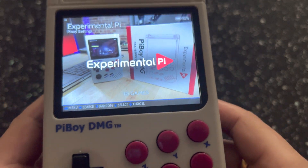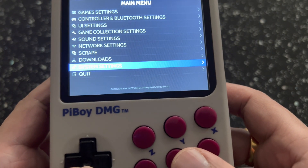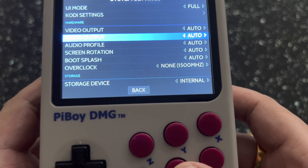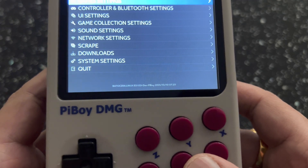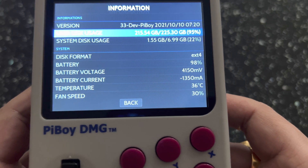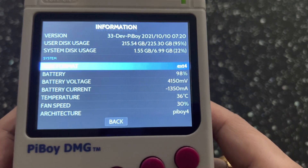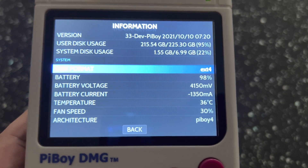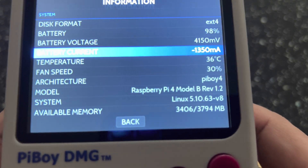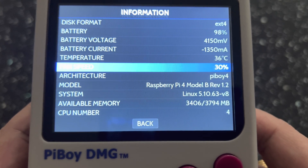You can see you have a battery meter here. You can bring up the menu. Let's just go to the About screen so you guys can actually see a bit more information about the device. So under System Info, right at the top — the format is EXT4, which means you're going to have to mount it to Linux to add your games, unless you have some sort of file system on Windows that allows you to do that, or you can use other software. Battery is pretty good — it gives you your battery voltage and current, along with the temperature, which is running at 36 degrees, which is a decent temp on idle.